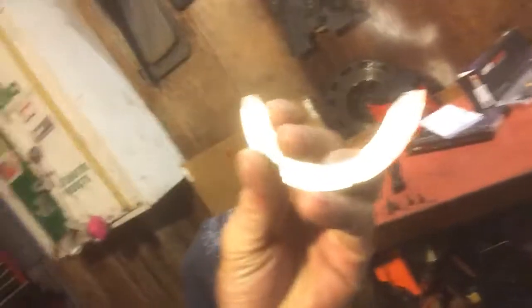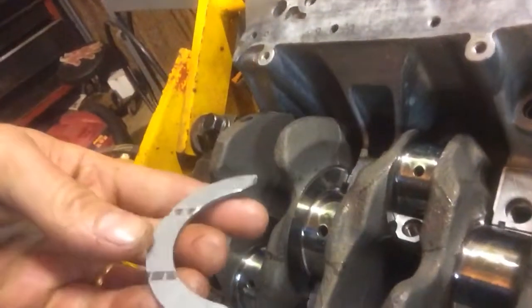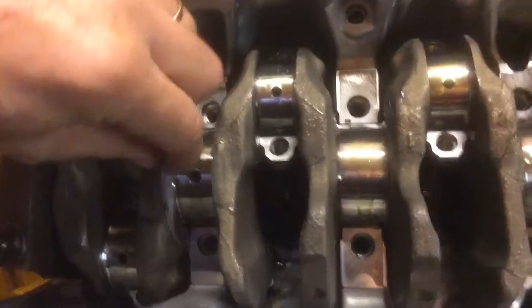It's showing on each side, but this is what it looks like right here — it's a crescent bearing and it has oil galleys on one side. So where that guy goes, you see this shiny part right there — those oil galleys go against that, not to the block. You don't want them against the block because your block don't do nothing, it just sits there. The crankshaft needs to be lubricated, so the oil galleys they're gonna go to the crank. But it sits on the inside of the block.